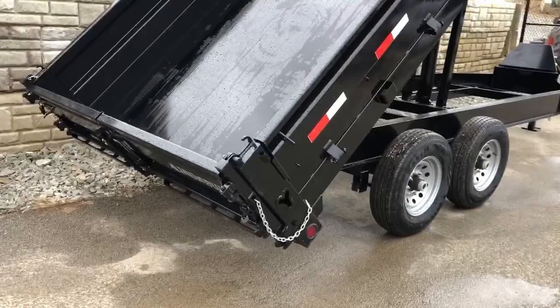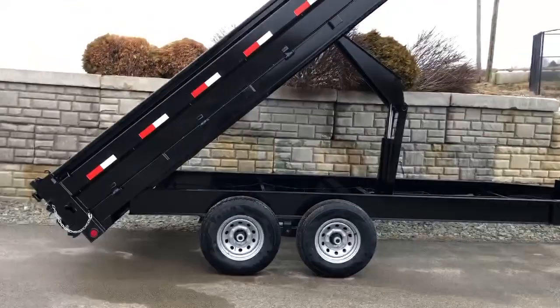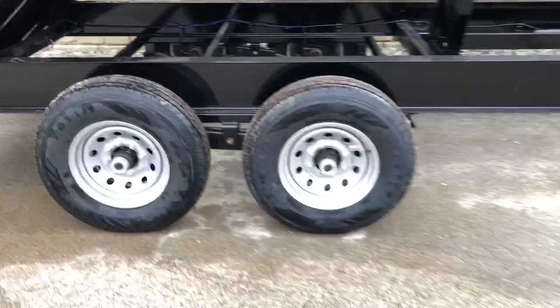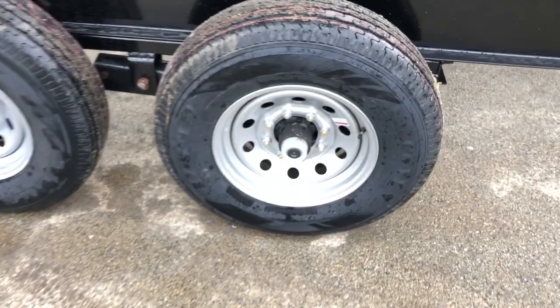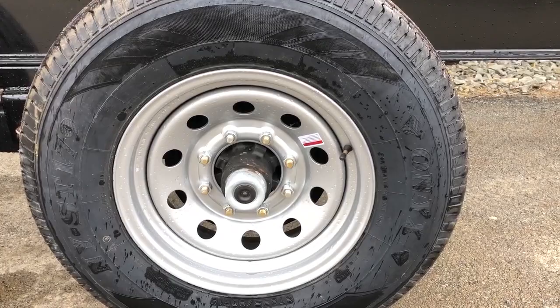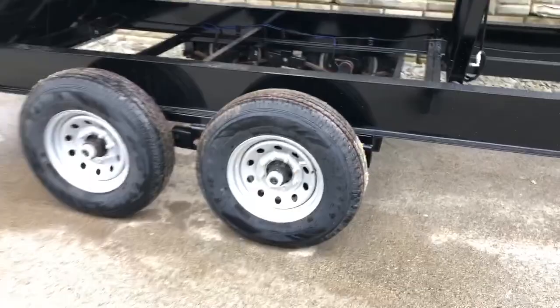If you do build your sides up, they give you a cap at the back you could potentially use to help build it up all the way around. This trailer is powder coated and has Dexter brand axles with never-adjust brakes and EZ-Lube hubs, plus a slipper spring suspension. Slipper spring is a little bit heavier-duty suspension than what you would typically get on an eye-to-eye suspension, generally found on heavier-duty units. A heavy-duty detail: they put a 9/16-inch stud instead of a half-inch stud. The EZ-Lube hubs mean the homeowner can do his own bearing maintenance — simply pull that black cap off, there's a grease zerk behind there, and it's fairly simple per the owner's manual.